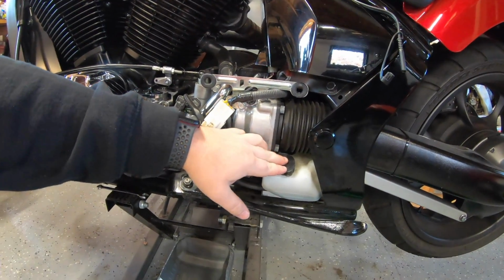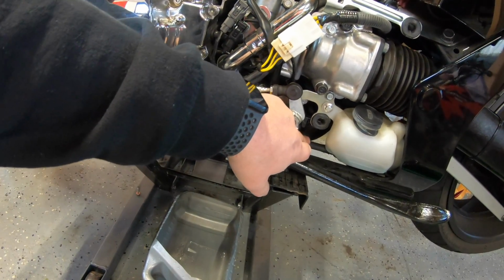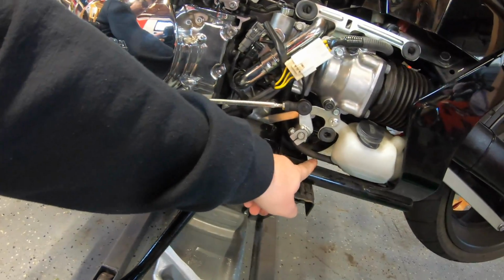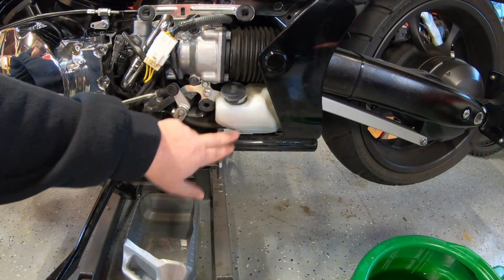As the bike warms and heats the coolant, it creates a vacuum. That vacuum helps cycle through the bike itself. Now, things expand, so it needs to go somewhere. Liquid expands, so it will expand in the reserve tank. At the bottom of the tank is a siphon hose, this one here. So as coolant expands and goes through the bike, through your normal cycles, it will go into this little expansion chamber here. As the bike cools down, the siphon will pull the expanded hot coolant that has cooled down back into the system. That's why there's a full and a low line.